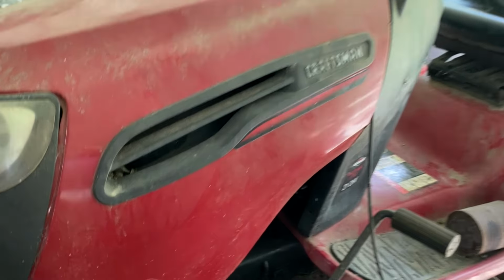Look at that. With the John Deere finished, the shop's pretty much empty, except for dog prints. Let's get the next mower in here. So about a week ago, we decided this was going to be a parts engine. I stole the coils. I stole the starter. Now I need to find a starter and two coils. It needs a crank seal, and we've got a whole other V-twin 22 horse for the Craftsman project. I'm going to do something different with the exhaust.